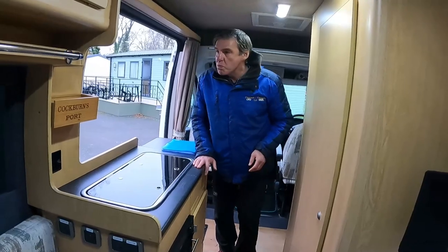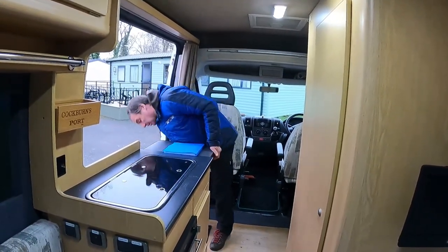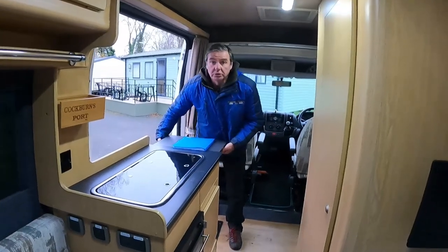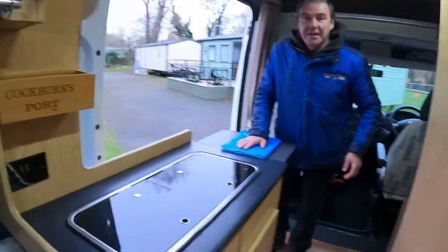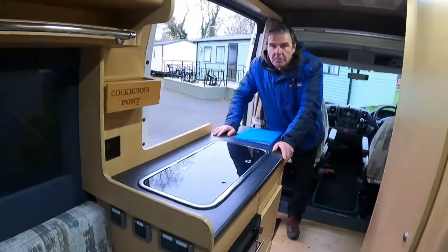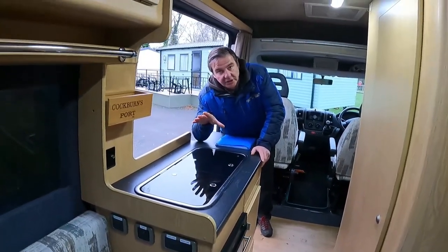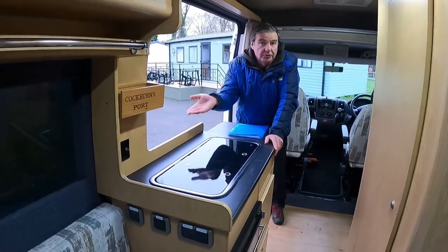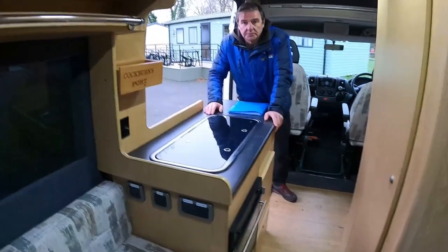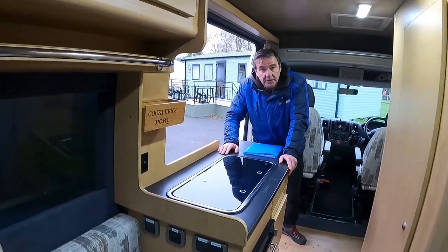We don't buy many of these self-builds because there are some dodgy ones on the market. They've not been done properly - the gas hasn't been done right. If you're thinking of buying one, get someone who knows what they're doing to check it out. You'll get ones where the gas bottle is in a cupboard with just a rubber hose straight through to the hob - you can't put a rubber hose onto an appliance directly. You need the gas pipe from the appliance going to the regulator, and then you can have rubber hose to the regulator, but not to appliances. And as we showed, you need a drop vent, and all your electrics earthed properly. It's a job that's got to be done right - remember, you're going to sleep in this thing and you don't want it bursting into flames.